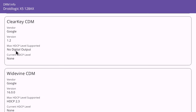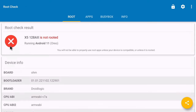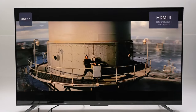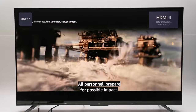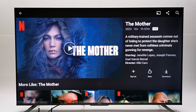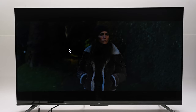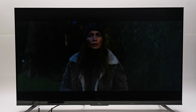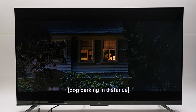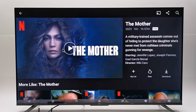Besides its live TV server feature, you can use it as a standard Android box. It has Google Widevine Level 1 with HDCP 2.3 protection and it's not rooted. With this level of protection you are supposed to get services such as Prime Video and Disney Plus in HD and 4K. However, in my Prime Video account it can only play up to HD 1080p with HDR. Netflix will only show in basic 480p due to the lack of a Netflix ESN certification. However, there is a workaround to get Netflix in at least HD 1080p by sideloading a modified version of the app — this is not a hacked version; it utilizes the box's Widevine Level 1 encryption together with your paid subscription, granting you at least HD 1080p once you are paying for an HD account.